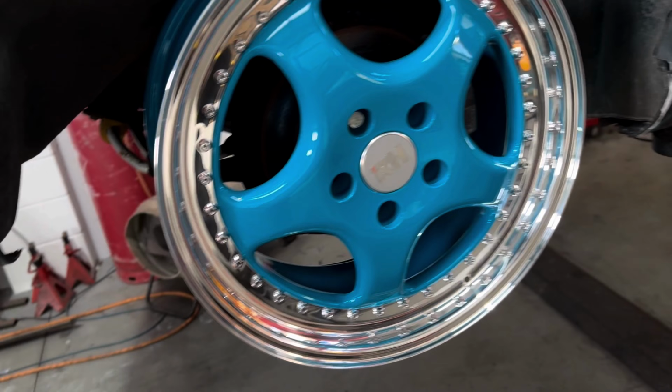Right, we're touching. 10mm, this is going to make it even more awkward to work out now. So we're going to need a 10mm spacer on the back wheel, and yeah, we're just going to have to figure this out. So it's going to be 10mm further out, whatever size the dish is. Right, let's have a look. All right, we've got here 15mm. So 15mm spacer clears and also clears there. So let's just move on to the front.